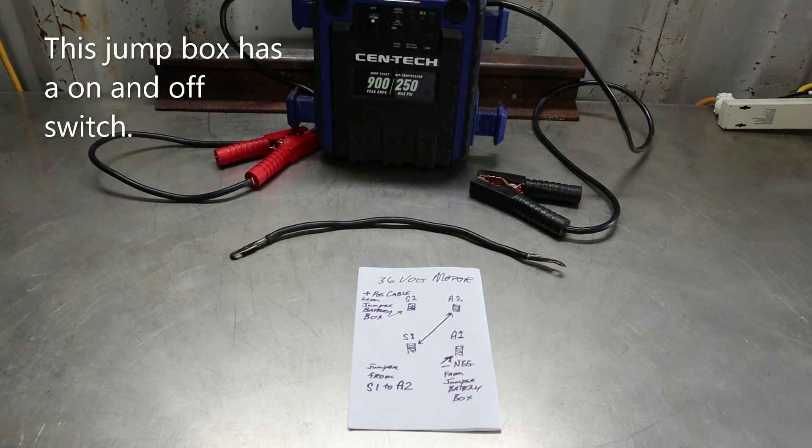I'm going to get ready to test my 36-volt motor on my golf cart before I do any further work to it. I bought it very inexpensive, so I'm just going to test the motor to make sure that it is worth proceeding from here. I'm going to test my 36-volt motor with a 12-volt jumper pack. You can use a car battery with jumper cables — 12 volts would be fine. It's very simple, it seems to be.